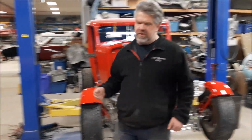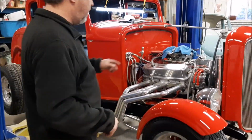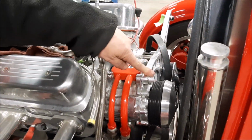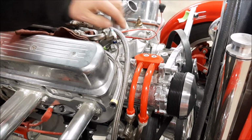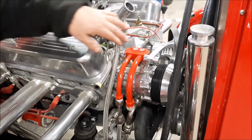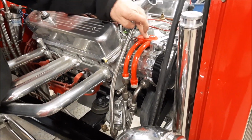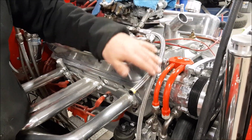And then we come around this side. Oh, the other thing I forgot to point out, the March system that we've got. So the client has the March, they call it the bat wing style, a lot of polished items on it. This March AC, these two tubes, they were badly corroded. It wasn't really chrome, it was kind of a polished tin. So rather than spending our client's money to replace this piece, I media blasted it and powder coated it.